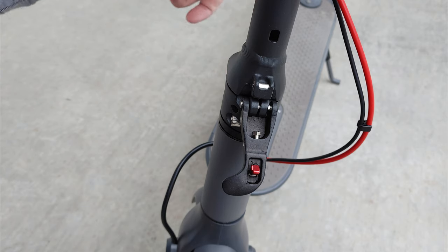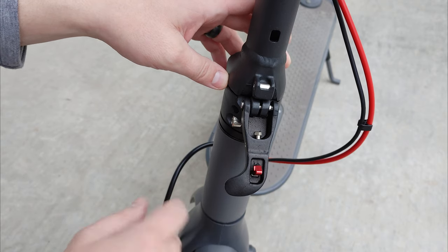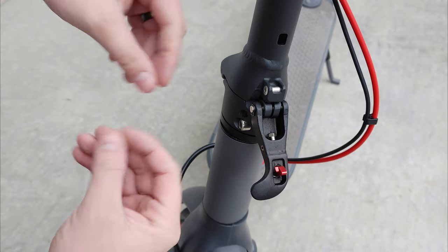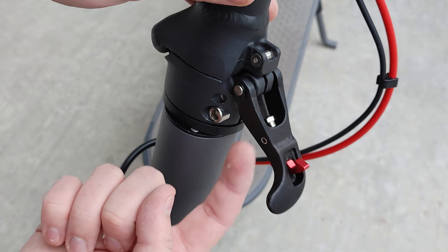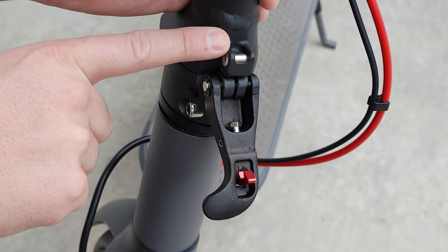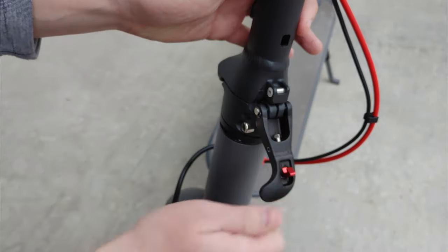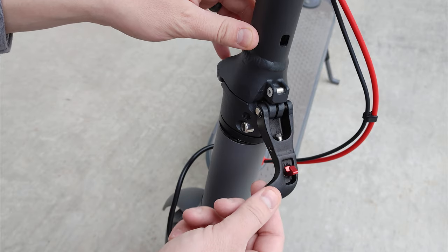This style of folding lock can be tightened down fairly easily to make sure the scooter is rock solid. If you get this scooter with this type of locking mechanism, it's really easy to tighten it down. There's a little grub screw you just back out, then the main screw loosens so it wedges better. You just have to play with it to make sure it's easy to press lock but with a little more resistance.